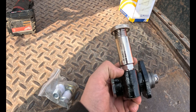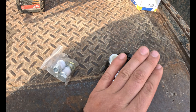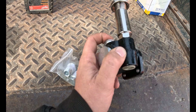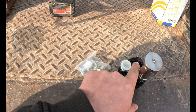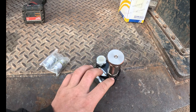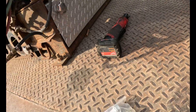The reason we're doing all this is that it's leaking out of the primer handle. Hopefully this is the correct lift pump. The only reason I bought a whole new lift pump instead of just an o-ring kit was that it was surprisingly cheap — only about 70 bucks. Hopefully it fits; it looks the same on face value and the ports are in the same spots. It's got some banjo fittings. Hopefully it's as simple as two bolts and some mounting bolts — in and out, prime it, run it.